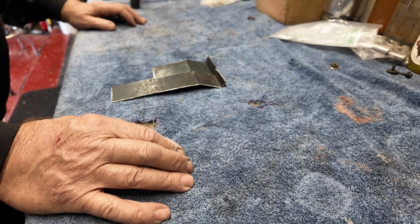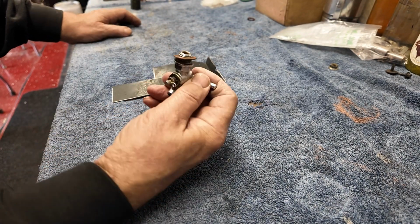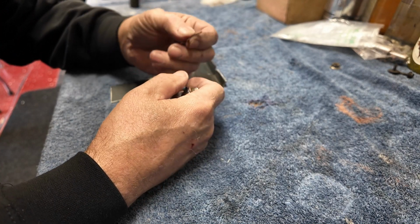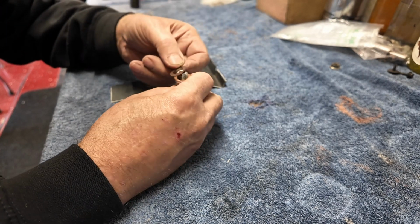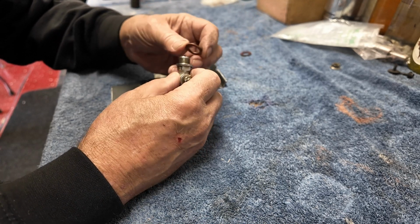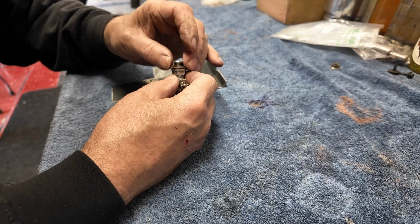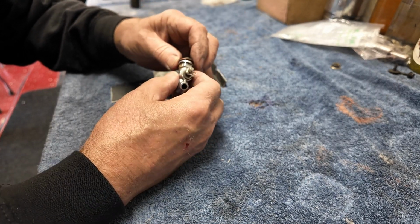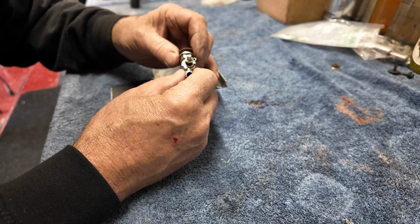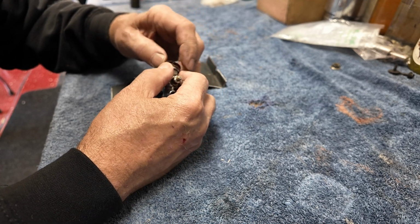Not hinge and bracket. Where are they from? Think about that one. Oh, and the other thing, I'll fit this in the radiator, but I've got to get a fibre washer. So I have to go down to my local hardware store and get a fibre washer that's that diameter. Just one washer. And the copper washer that's on there, that just gives it a little more surface area to tighten up. Okay. And there it is, all pretty with its nice new clipping. So let's go down to the hardware shop and get that.